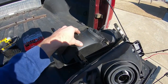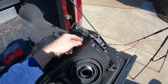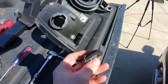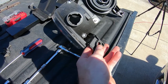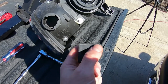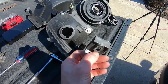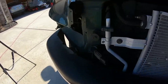I showed you removing the passenger side headlight - the driver's side is the same way. It has the rubber weather stripping, three fasteners, and the metal ribbed stud. However, be very careful, at least on some of these aftermarket headlights - it might not be made as well. I've broken off one of the mounting tabs. It goes back on, but that shouldn't be hard to repair with some JB Weld. Just be careful when you're pulling these out because these can snap off given the unique way these headlights have to drop down into that opening.